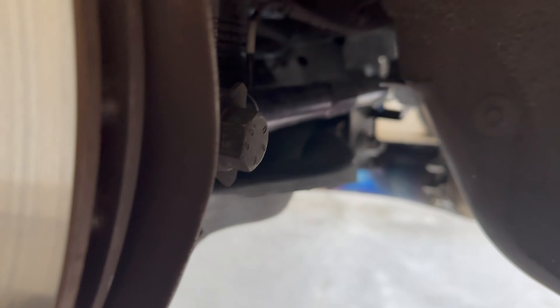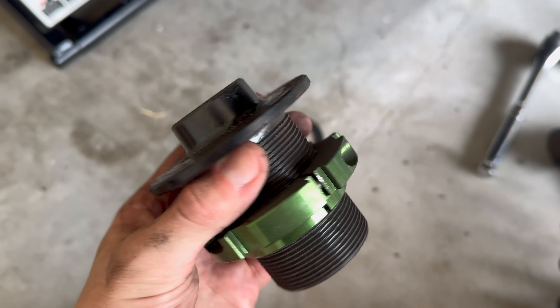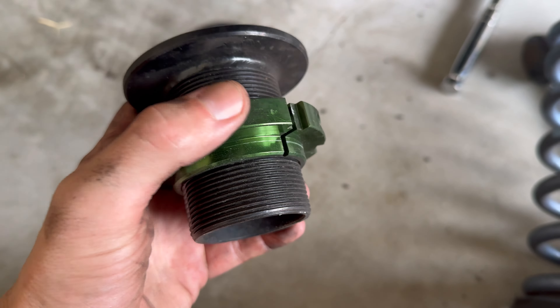I'm going to start removing these — it's relatively simple. It's just this bolt and this bolt, and then you should be able to just pull it down. That one I leave tight because it doesn't need to be loosened and it's your height adjustment, so don't mess with that one. The whole spring assembly is out — this is what it looks like. If there was a hole in this or a pin here, you could attach it so this doesn't spin when you spin the height adjustment. These are Swift springs.